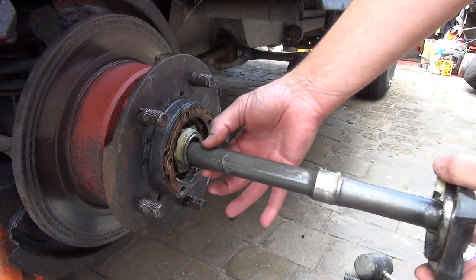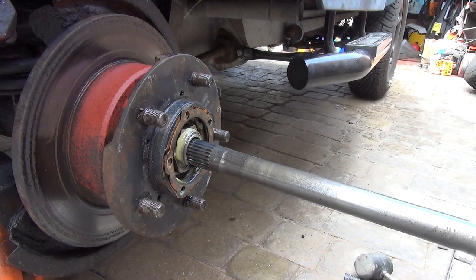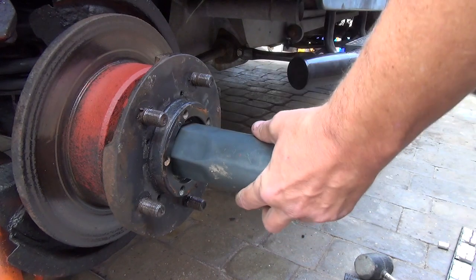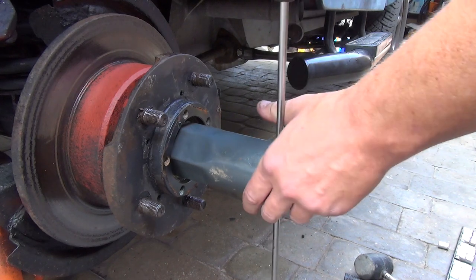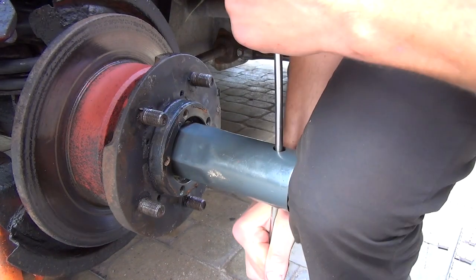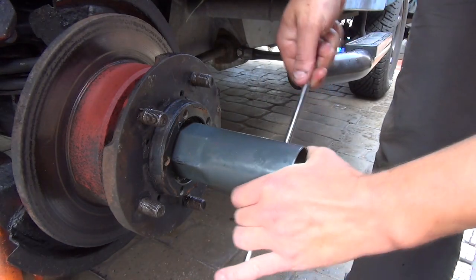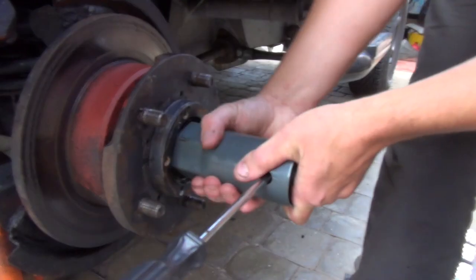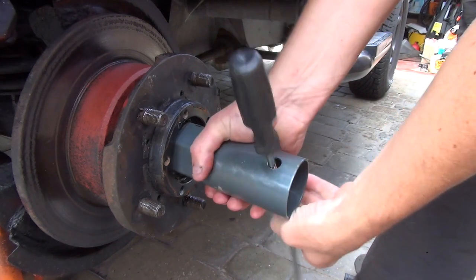Inspecting the half shaft as I bring it out — it has a gasket on there which we'll renew later on. Keep it somewhere clean; you don't want any dirt or grit getting into it. Next up, the hub nut — it's a 52 millimeter box spanner. One of the reasons I couldn't get mine to the correct torque settings is that this box spanner has no adapter for a torque wrench, so I had to guess it. That's likely why these bearings are damaged. You could be faced with one nut, a thrust washer, and then the bearing.